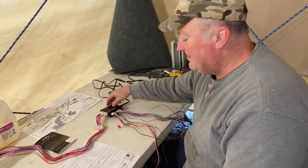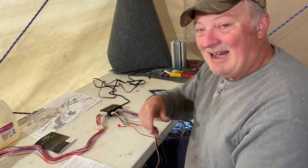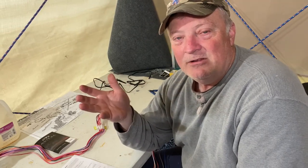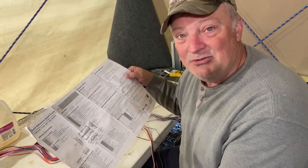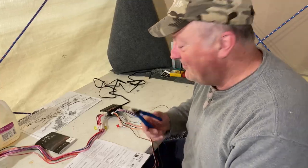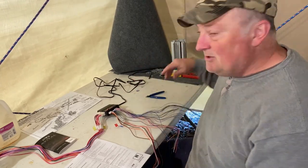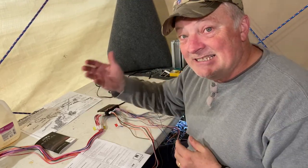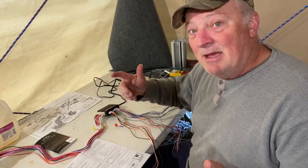Now that everything is put together in this wire harness, there are some things you need to check out. What are you actually going to use? I don't have automatic roll-up windows or automatic door locks, but maybe someday I will — or maybe you already do. Go through the list, determine what you need and what you can do without. Snip off what you won't need, but there's a caveat: plenty of wires in here just supply a programmable signal that could go to virtually anything — like underbody LED lights you want to trigger with the remote. Bundle those up and keep them out of the way for possible future use.